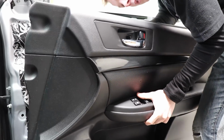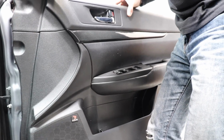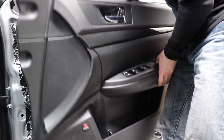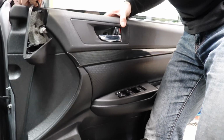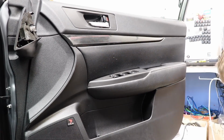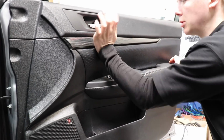Can you see what I do? Yep. Okay, let's put this on here. I need these tweeter wires to be up high enough to be able to get the tweeter in. I think I might need to plug the tweeter in first, because my tweeter wires are hidden down there a wee bit. Let's just sit that there. Get our tweeter, plug it in. Now we can put this up and down. Okay. That's the tweeter popped on. Okay, the door is completely popped on, but not screwed on.